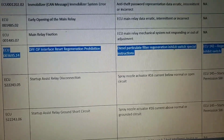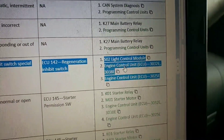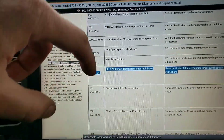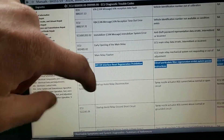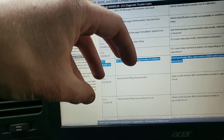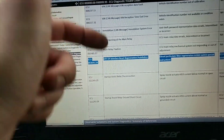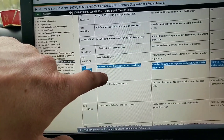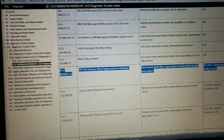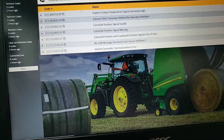There's another one: op interface reset regeneration prohibition - inhibit switch. It doesn't have a light control module on this tractor and it's all done in the ECU. Nowhere do they tell you that codes like the cam sensor code will cause this, but I'll tell you: any kind of air throttle, EGR valve, cam sensor, crank sensor - basically almost any sensor on that engine short of engine cooling temperature and oil temperature - is going to inhibit the regen from happening.